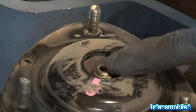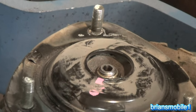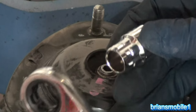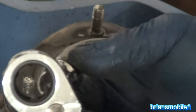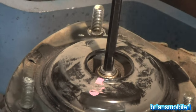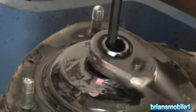So glad I'm replacing these. You know what I love about Subaru and Japanese manufacturing in general is they make a way for you to service their stuff — it's so stinking serviceable. There are a whole bunch of different ways that you can do this, but my favorite way is to use these Craftsman pass-through sockets. You see the socket's got a big hole in it, and so does the ratchet that it interfaces with. I'll leave a link in the description for these. And then this is just a six millimeter to the inside — you can see that holds on to it pretty good.